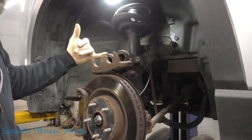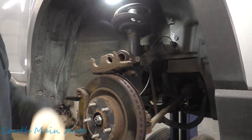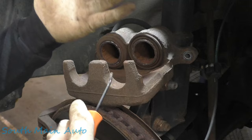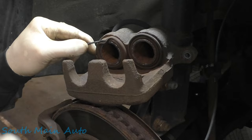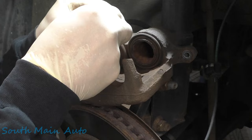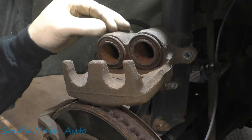You don't have to, but the chance of pinching your boot in the pad increases if you leave it like this. See how this boot folds back on itself — this one's still puffy. If you put it on your caliper bracket and you accidentally bend the boot over and it gets pinched between the caliper and the pad and you don't see it — as that piston comes out it'll rip the boot. So just come at it like this, push it back, wiggle down in that groove, pick it up a little bit and you'll see it suck right in. Then just let it down. That's all prepped.